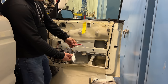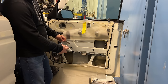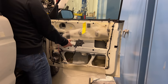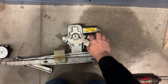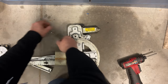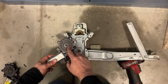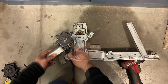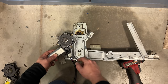Now I've replaced the connector on the motor. It's just a two wire connector. I put the opposite connector here. I'm going to plug this in and double check that this works before I install it. Try the switch up and down. Looks like it works. The old motor is held in by these three bolts here. You can see how the gear on the motor engages the gear on the regulator and makes the window go up and down.